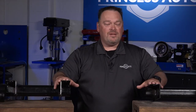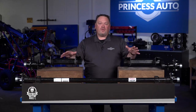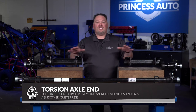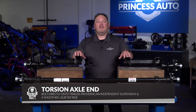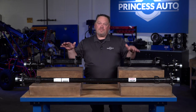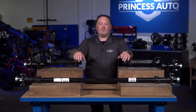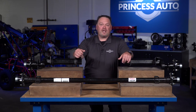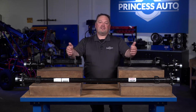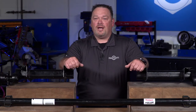You also have another type of axle, which we call independent, or posi-flex, tor-flex, depending on the brand. Some of the differences are that you're not connecting both hubs to a center beam or bar, and it gives you a bit of an independent ride versus a solid ride. Springs and hubs are all connected when it comes to the straight axle. Selecting your axle based on independent versus straight just gives you those different options.